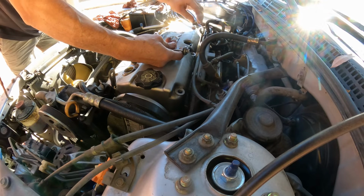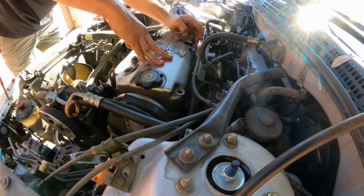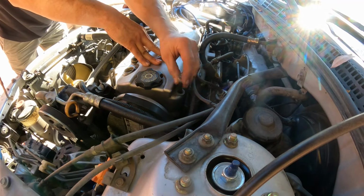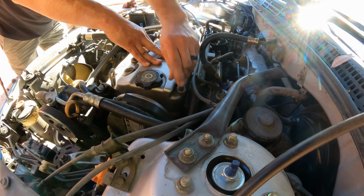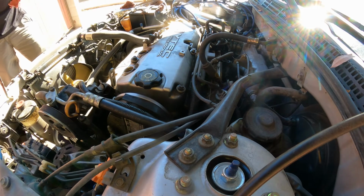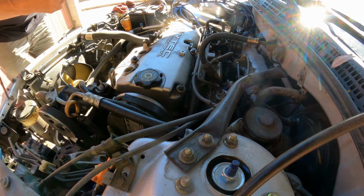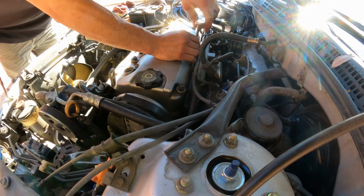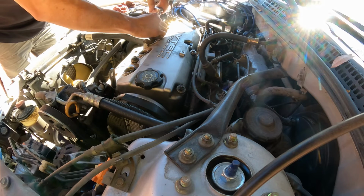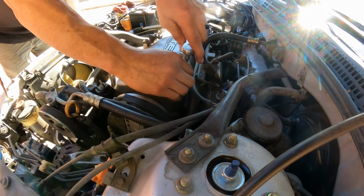You've got to tighten it by hand. You do not want to tighten it with an impact, because you have to remember this is a very thin thread. So you don't want to try to rush at the last minute and just strip the thread. Then you're going to spend more time fixing it than the whole repair. It's a very, very important note here. So go easy on them, and don't forget to take your time.